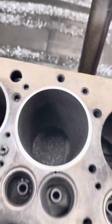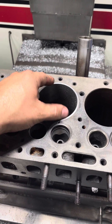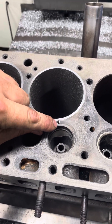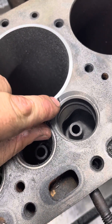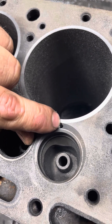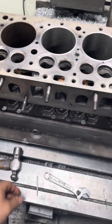The crack went probably a quarter of an inch or so in the sleeve. Basically what we did is bored the original sleeve out, put sealer on the sleeve before we pressed it in. What we're doing right here to fix this surface crack — it actually stops right at the end of that hole there. There was a crack that ran from here to the sleeve.